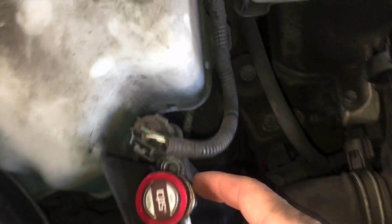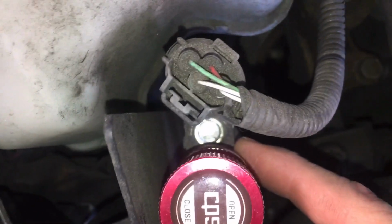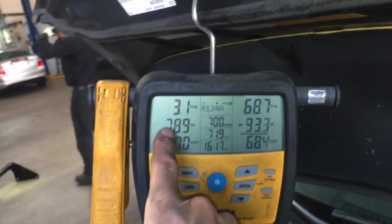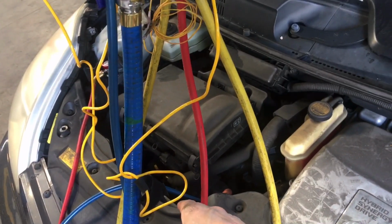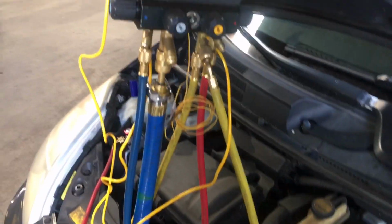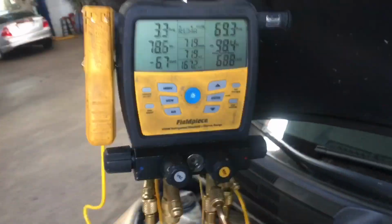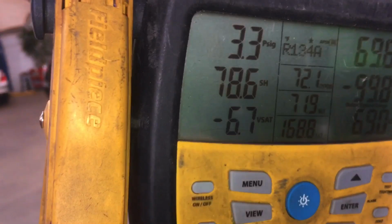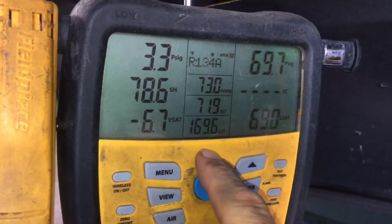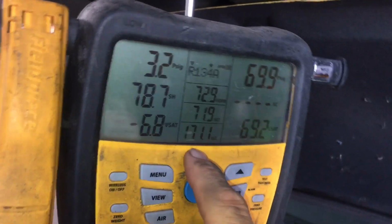So, low on refrigerant, as we can see right there. Indicator of low on refrigerant. Calling for full cooling, and the compressor is whining itself out, burning itself up, doing a nice job of shortening its life. And suction line temperature. And we've only been running a few minutes. This will climb as the compressor case core and all the mass heats up.